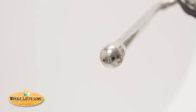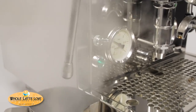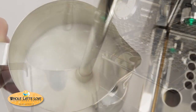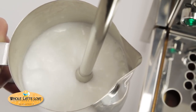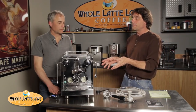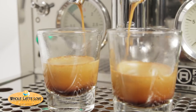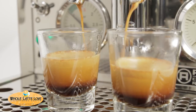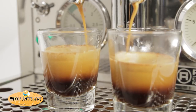On the side there's the steam wand, which comes with a two-hole steam tip. It releases a lot of pressure quickly, so the pressure in the boiler does drop a little, but it does a nice job — gives a good roll and you can steam eight ounces of milk without a problem. The machine also has a commercial-style rotary pump; RPM is the brand, very high quality, found on many other rotary pump espresso machines. The pump pressure is adjustable from underneath the machine, so if you ever need to adjust it, it's easy to access.